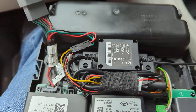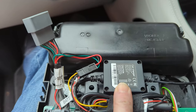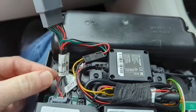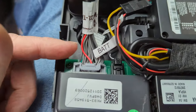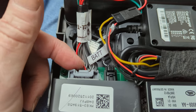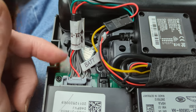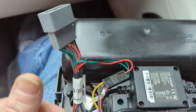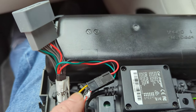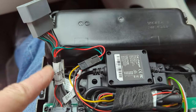I've done most of the work in the overhead console as you can see by the bundles of wires. This is the dash cam converter — 12 volts to 5 volts. The feed for it is really nifty. Lots of cabling I've done before required testing all the wires to find which ones are live, which are ignition-based, and which are negative. This is a nice breakout cable that identifies those three for you. I've connected it into a little molex and into the converter.